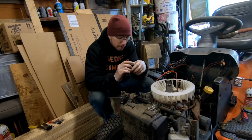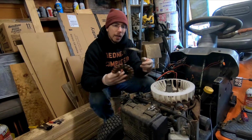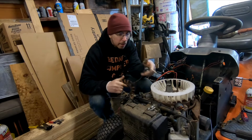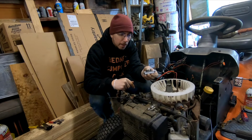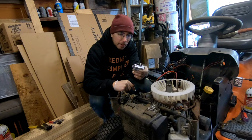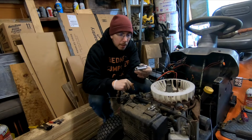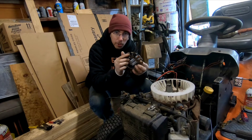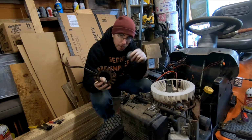which is what you end up needing for your tractor's charging system. Now, these Kawasakis are a little weird in that they come out with a two-prong from their alternator or their stator, and it goes into one side of the Kawasaki rectifier. You can buy a universal rectifier for about 15 bucks off of Amazon. The Kawasaki one, I'll put a link down below, is about 35. The stator itself for Kawasaki, there's not much you can do about that. It's just plain 80 bucks no matter how you look at it. I'll post a link down below.